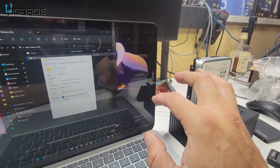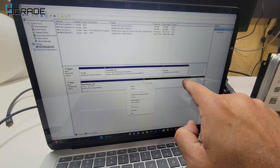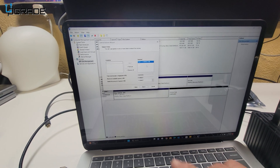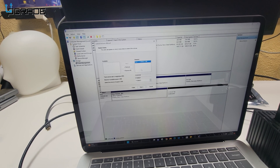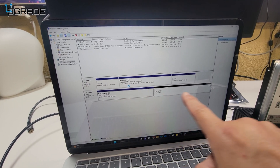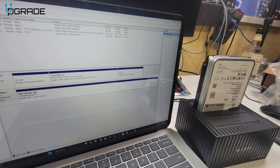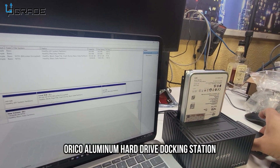Whenever you have this problem and it doesn't read the whole drive, you can always extend the volume. You need to know exactly how many megabytes or gigabytes the complete drive is. When you click 'Next,' it asks what volume you want to set up — select it, move it to the right, click 'Next,' then 'Finish.' It took about two minutes, but there we have it — the entire 14 terabytes as one. Using PC, I went back and made the changes easily, extending from a two-terabyte to a 14-terabyte drive. Very simple and easy to use.